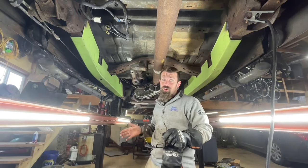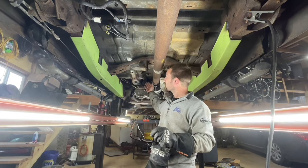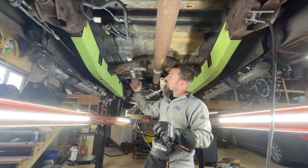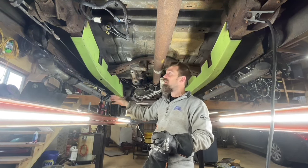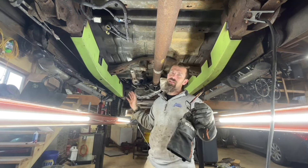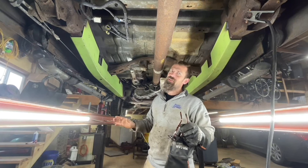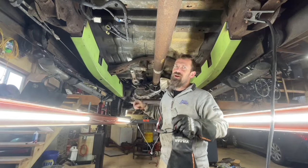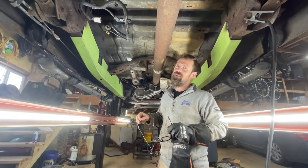Now I'm not going to bore you with all the details. Now that I've got everything tapped in, I'm going to use the clamp and work my way back making sure everything is clamped tight as I weld. I'm going to weld as solid as I can around everything. I'm not even going to do a time lapse on this — it's going to take a while. But now you can see where I'm going with it, so I'll check back when I've got it welded in.